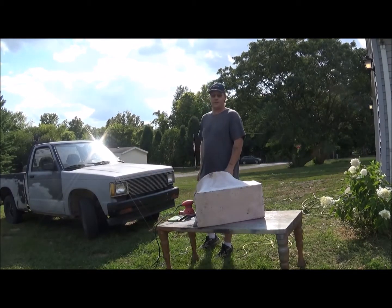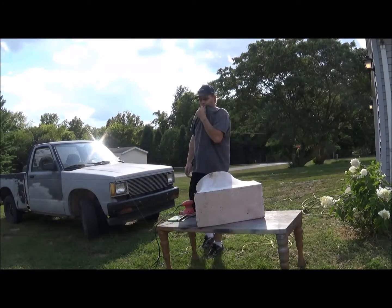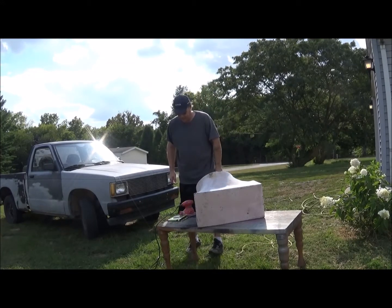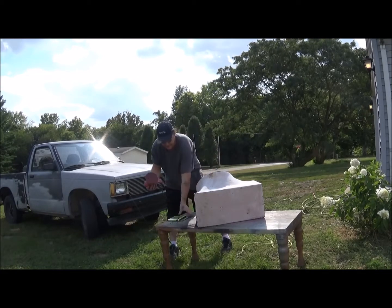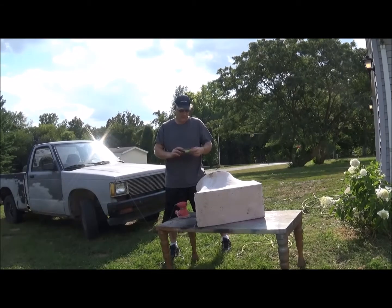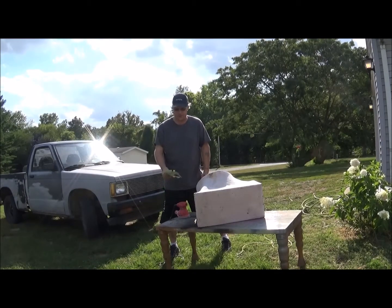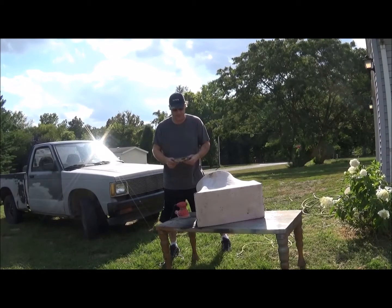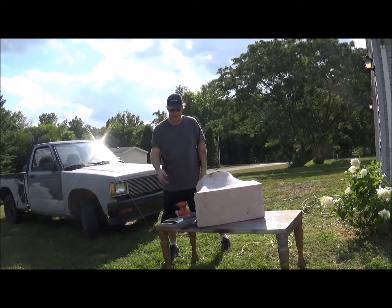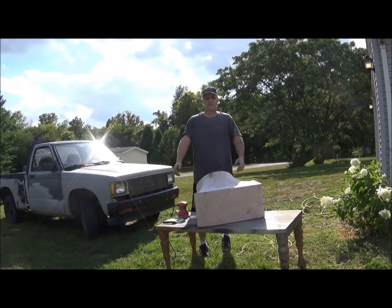So I'm going to have to hit it with the sander and knock it down some, and smooth it out a little bit with some body filler. We got our sander and we got our 120 Gator grit. I just get this stuff from Walmart. It's actually pretty good. It's pretty durable. Lasts a while. I usually get the 12 disc pack, project pack, and it suits me.